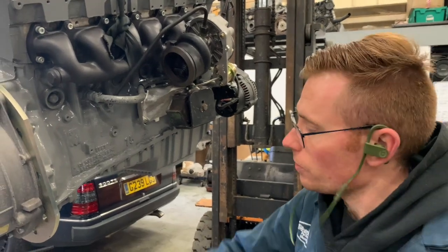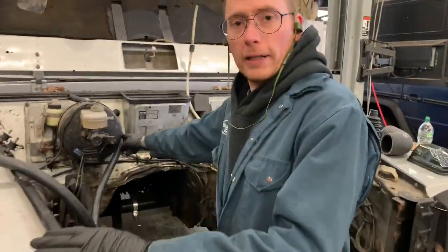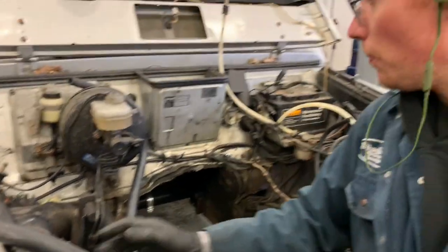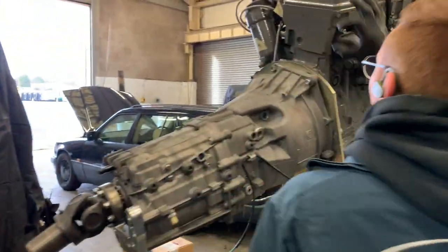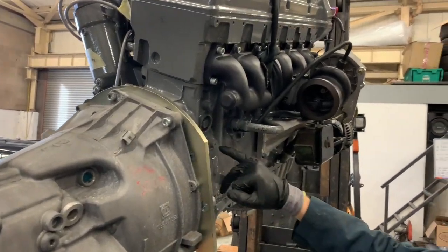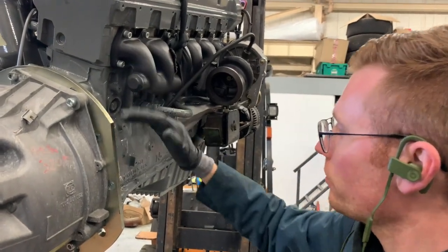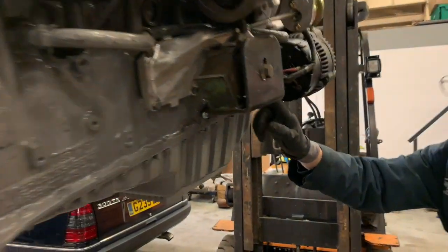And also what I'm going to do is tap one of these fittings here, because if you look, I've already cut back the original heater matrix pipe. I've added on the length of this 19mm internal pipe. Now that pipe is going to come out somewhere around here, and then it's going to come down. And what I want to do is P-clip it down here so that it's clear of all the manifold and other bits and pieces, because we're going to have to connect it.